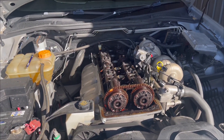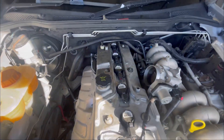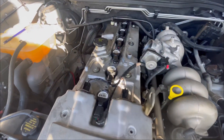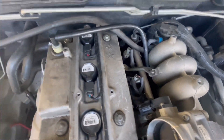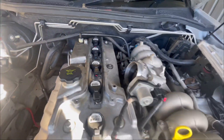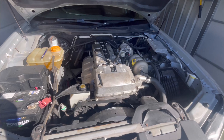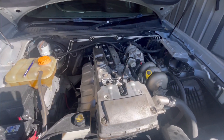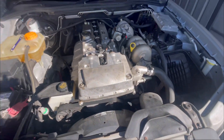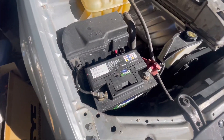It's all back on. I got out as much of that gunk from the rocker cover as I could — nothing fancy, just scraped it out with a screwdriver. There was a shit load in there. That wire's not pinched anymore. I checked the wiring on the sensor at the back and that's all good too — just need to put some new conduit on it. I'll put better conduit than what's there anyway. I just want to give it a scan now and see if it throws any codes. I'll leave the coil cover off for now and just sit the intake lid back on so nothing goes into the throttle body. I might take the battery out and swap in the one from my car just so I'm not messing around with jumper leads.